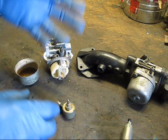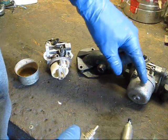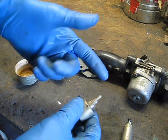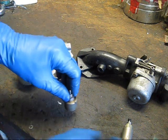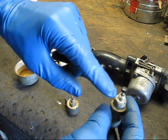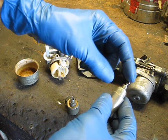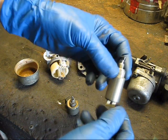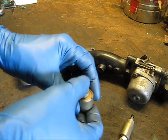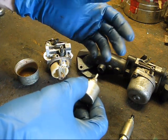How do they fail? Typically when these fail, they get stuck either up or down. Being that they are at the bottom of the carburetor, any sediment, any contaminants, any moisture in the carburetor will tend to gather in the bottom of the solenoid. Either they stick or they rust — and the rust is really the bigger issue. What often happens is moisture gathers in the bottom of the solenoid and rusts the spring. So you can compress it and pull it back out manually, but the solenoid will not extend on its own. That's a very common failure mode, especially on the Nikki solenoids in particular. If they don't rust, the next most common problem is that they just get stuck either up or down.